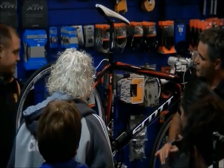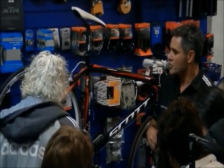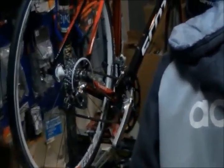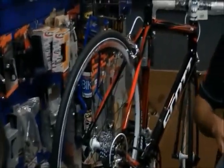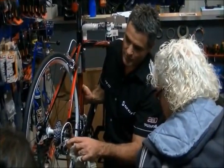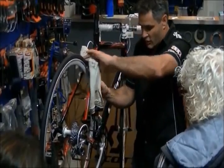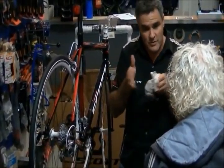There are other areas of your bike you can lubricate — for example, if things are a little stiff or the gears aren't working properly. With a Teflon-type spray lube, you can lubricate your derailleurs and your brake pivots. Don't get any spray near your brake pads or braking surfaces. The spray goes into all the pivots and little working parts, then just wipe the excess off — you don't want that excess there as it will contaminate. It's amazing how a little lube on a stiff brake can make it work much nicer.